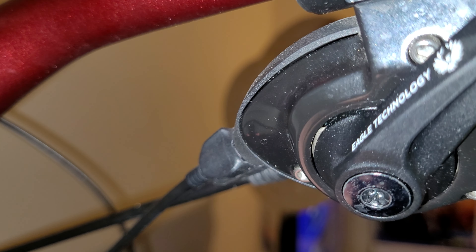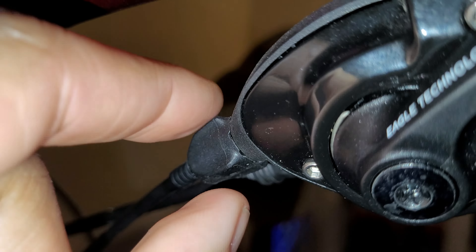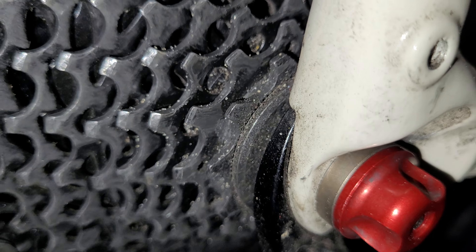This is a video about how I set gears. On this rear derailleur, you've got an Allen key bolt — that looks like it should be either a 4 or 5mm. You want to loosen that bolt so the rear derailleur is on the bottom, the small cog you see on the right.